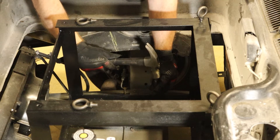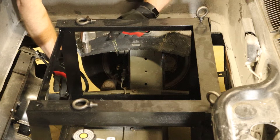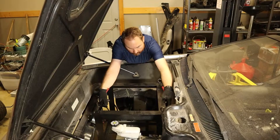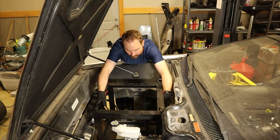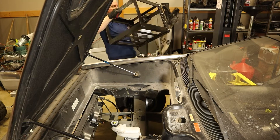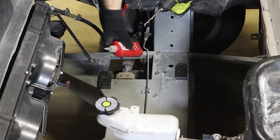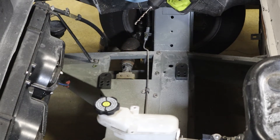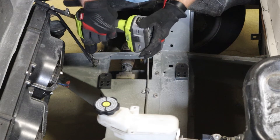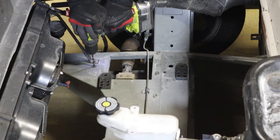The first thing I'm doing is using a center punch to mark the location for where I want the bolt holes in the frame. Then I can lift up the empty battery box to get it out of the way and start drilling. I'm using a liberal amount of oil to drill into the frame. This is an aftermarket frame made of stainless steel, and drilling through stainless is much more difficult than drilling through regular mild steel.